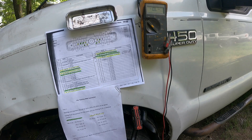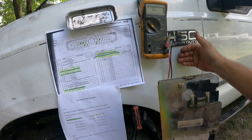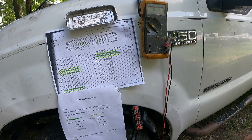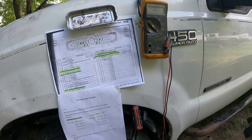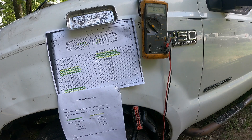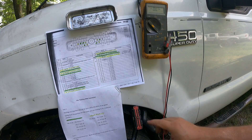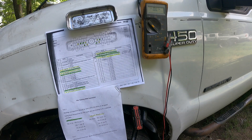If that's not it, it could be this bad boy — the IDM — which sits right underneath this Ford badge right here, and the plug goes right into it. Just be real gentle when you plug these in, soft-handed, to make sure you don't bend any of the prongs. Inspect all your prongs — make sure nothing's bent, burnt, or corroded. Then gently get it plugged in, start the 10mm bolt, and when you walk that bolt in it'll seat the plug for you. Just snug it — don't get crazy or you'll break the nut off. That's checking the wiring from the IDM.